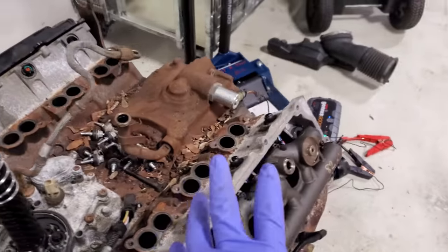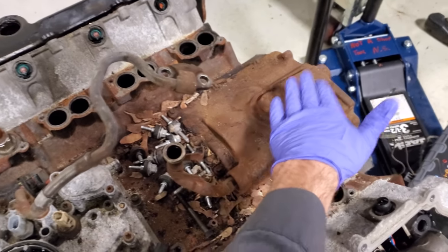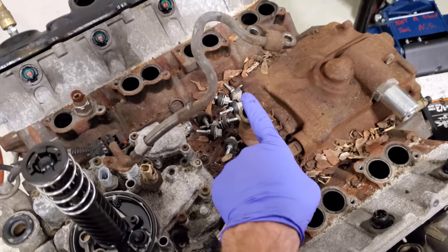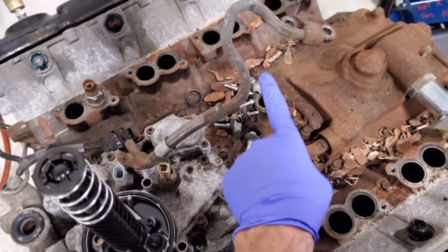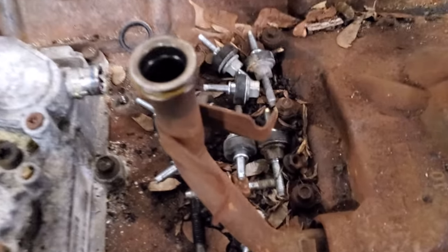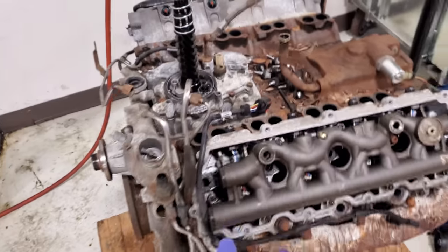It has been known that if you had a bad Rexroth pump — the aluminum-style '03 pump — and there was a problem with valving or something internal, you'd be hearing gurgling coming up through the turbo oil drain. I don't hear any gurgling coming from that drain tube right now. I'm going to take power off, shut it off, and you can hear it start making its noise again as it dumps back into the crankcase.